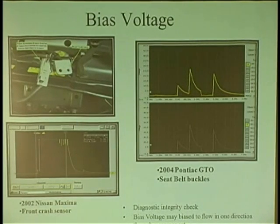I followed all the way back to the controller. Let's say an ABS controller, had tons of them on Bosch 5 systems. I go right to the controller, I have a ground, I have no 5 volts. No voltage here. I check the other 3, so I have it. Meanwhile, the computer's saying, open circuit left rear sensor.